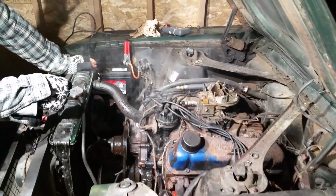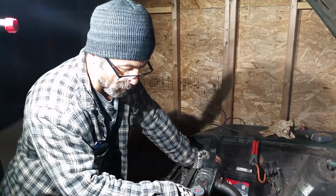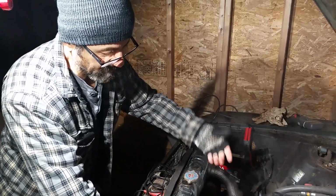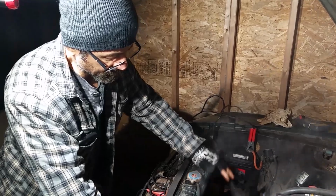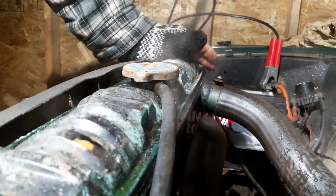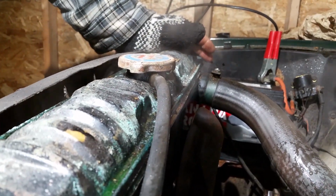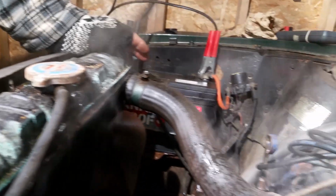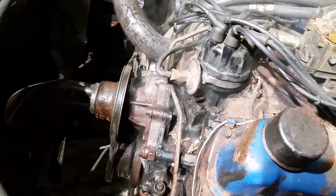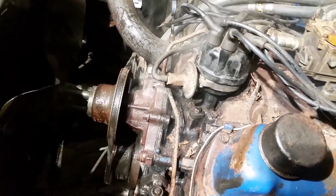So as soon as pressure was built up, even cold, it started to leak slowly. And then as the heat rose, the pressure increased because it got to expand, right? And so when we shut it off, it was already at the halfway mark. As all you Ford Mustang owners know, they typically don't run at the middle of the temperature gauge. They run at the low. Anyway, up in Canada, they run cold.